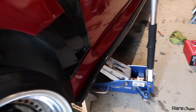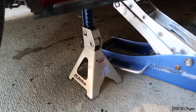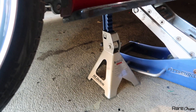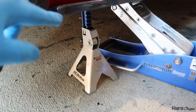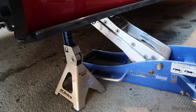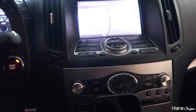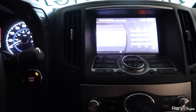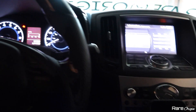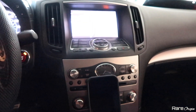Basically what I did is remove the oil catch cans, removed the two bolts from the bottom, and emptied the old oil. Now we're ready to put brand new oil in. Let me bring the car down from the jack stand — remember, keep it safe, don't go under your car without jack stands. Everything is reset: engine oil, oil filter. The car sounds like it's running smooth.